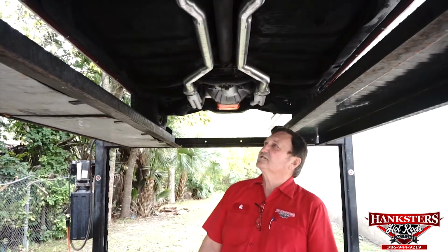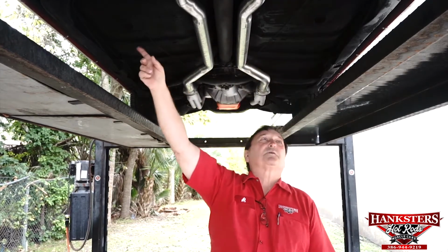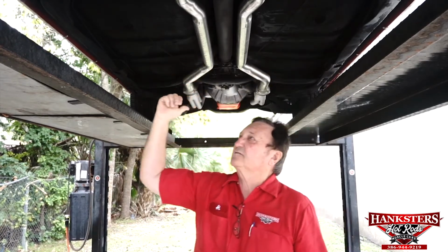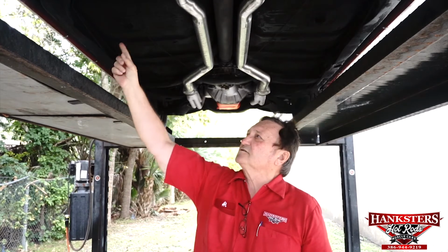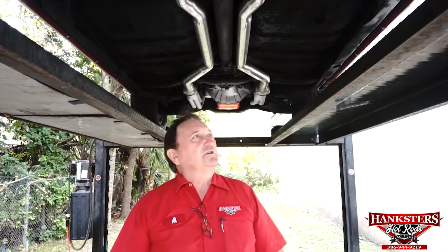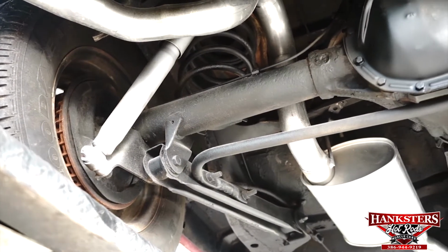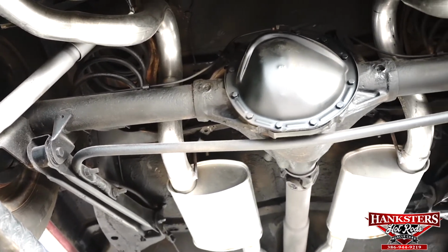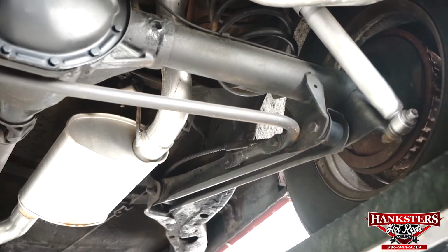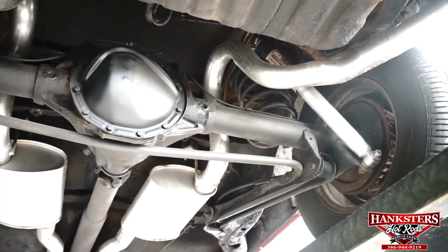Okay, second half of our 66 Chevelle. Again, the substructures on the floor is totally undisrupted. Absolutely no marks whatsoever on them. Rear floor pans, original, just like the front ones were. The C-channel transitions back into full box frame, again in the back, that goes up over the rear differential. The swing arms on the rear here are really nice. They're not bent up or distorted in any way. Has an F41 style sway bar in the rear of this. It's kind of rare to see that in here, but it does have an F41 style sway bar for the rear differential.